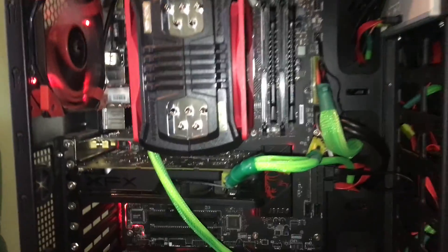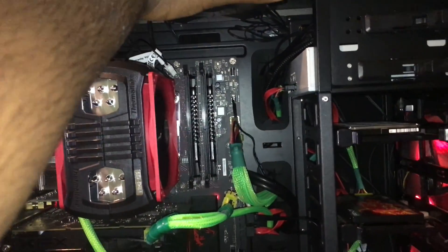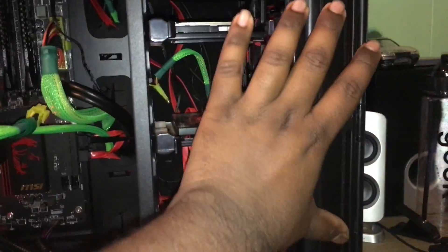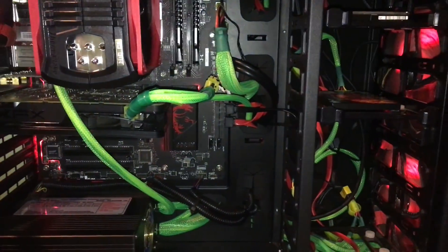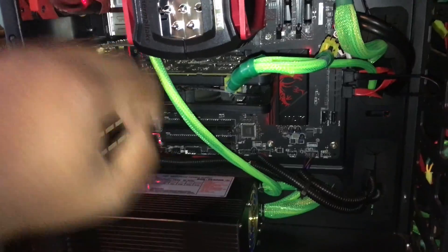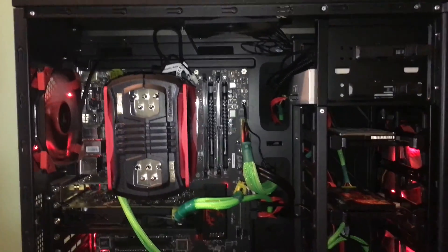I'm not using perfect terminology, but I'll explain it as best I can. I have two 120mm fans — one here and one here — running on super low, and then two 140mm fans here turned up a bit on my fan controller. By turning the big fans up, more air is let into the case than my exhaust fans can release, causing positive pressure. When you have positive pressure, since not all of it can be sucked out, air leaves through all the little pockets and holes instead of dust coming in.